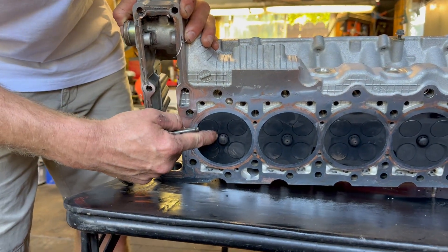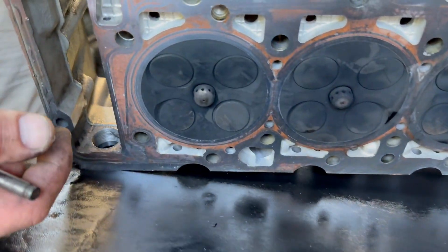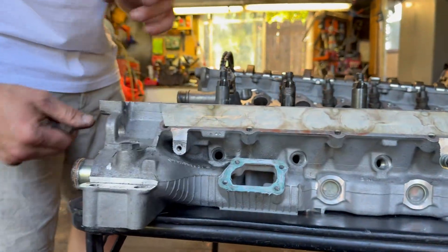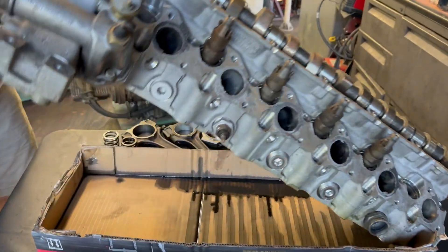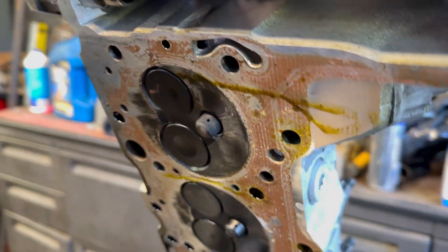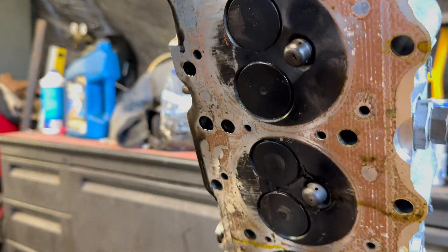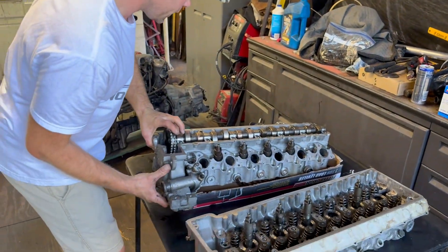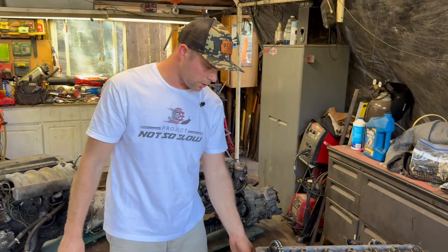The pre-chambers on the 606 have a lot of holes — many more than the 603. It's probably twice as many as the 603 pre-chambers. The 603 pre-chambers have maybe like four holes — a lot less. So that covers the cylinder head differences.